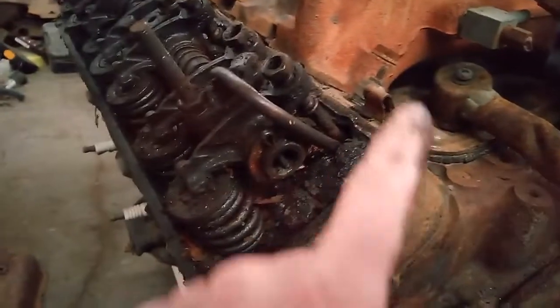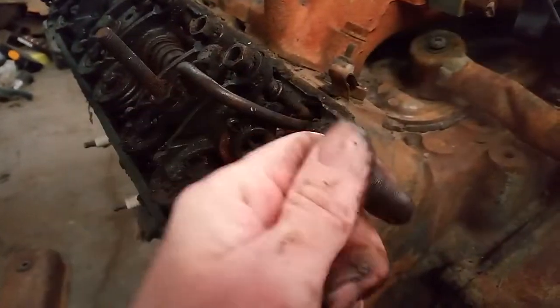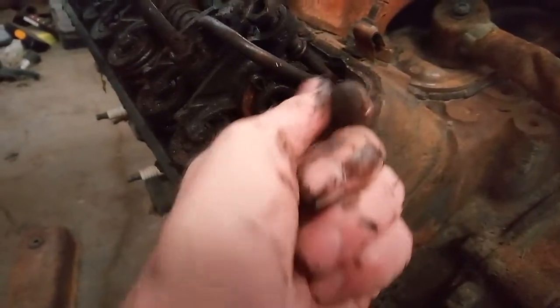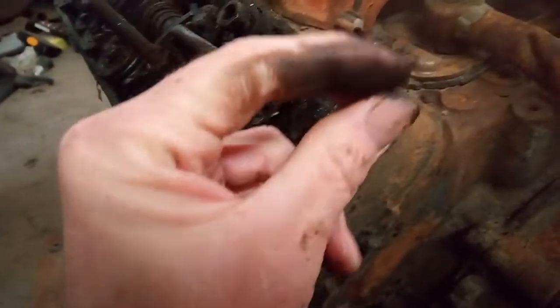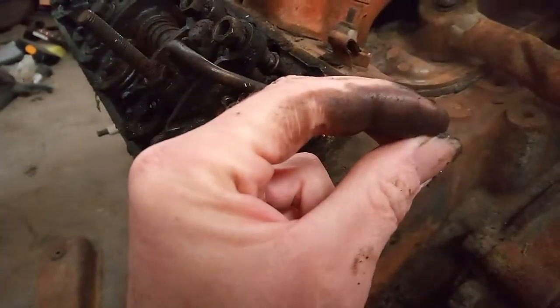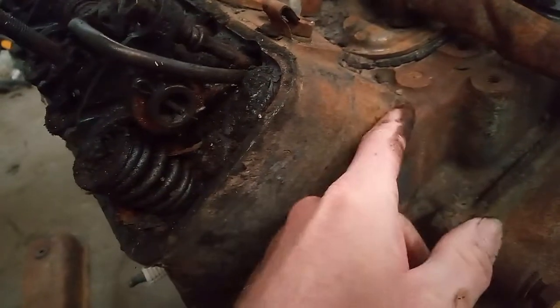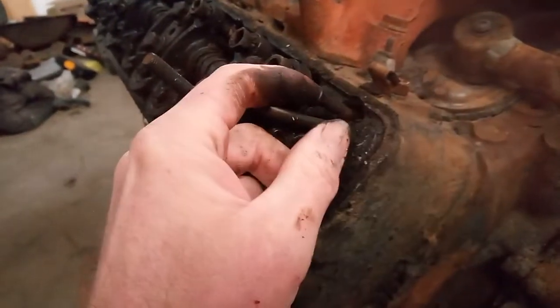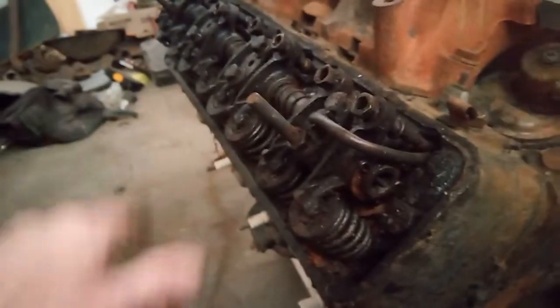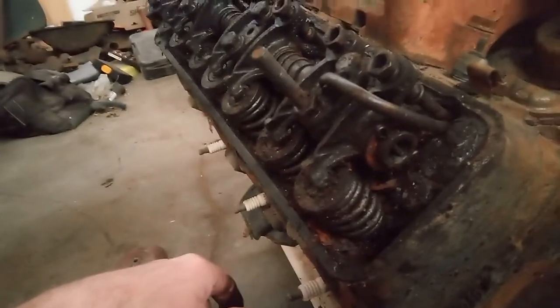So my first way is going to be to smash this, restrict it down. I'll put a piece of wire up in here and beat the hell out of it till it restricts, makes like an orifice to still get a little drain back onto there. If that don't work and I'm not getting enough oil up here, then I'll do McTim's method and I'll pull that out, throw it away, and I'll tap that and I'll pressurize that sucker and get as much as I can.